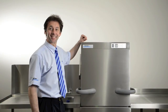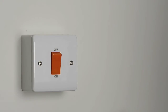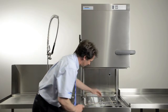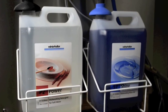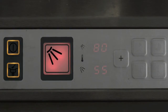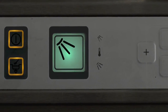Let's look at switching the machine on and starting up. Switch the machine on at the wall isolator — it will look like one of these. Next, ensure all the items are in the correct position, especially the wash filters. Now check the upper and lower wash arms are in the correct place. Check the detergent and rinse aid containers are full and primed. Do not load any items into the machine at this stage, and please close the door. Press the on button — the red light will come on. The machine will now fill and heat up automatically. When the machine is ready for use, the light will turn green. If you see any other symbols on the control panel, such as a spanner light, please speak with your line manager.